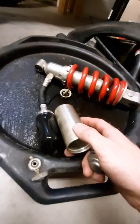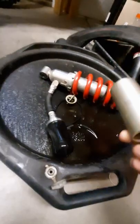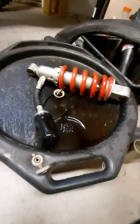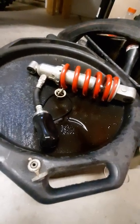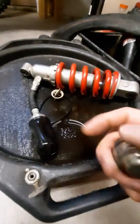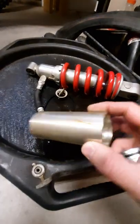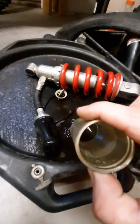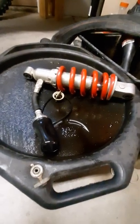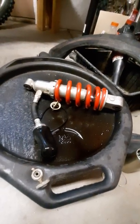This one has a small reservoir volume - considering the bladder size when it's installed, there's not a whole lot of volume. With whatever gas you're using, there's just not much room for the charge. So when it starts to bleed down, it's going to bleed down pretty quickly. If it had three or four times as much bladder volume, it would take longer to bleed down to the point where damping is affected. Once you get into cavitation though, it's just working like garbage.